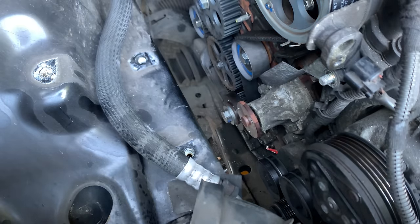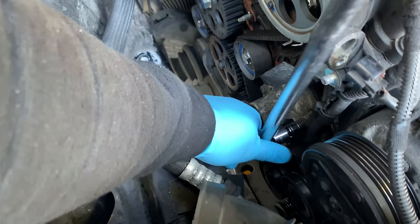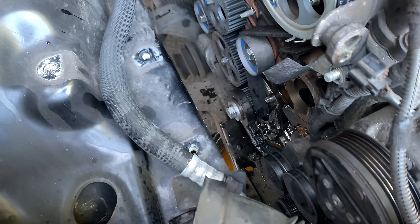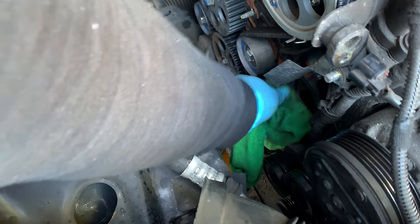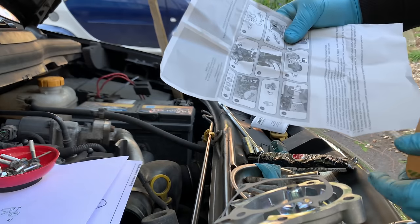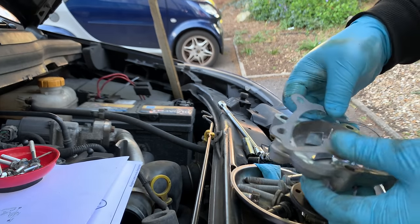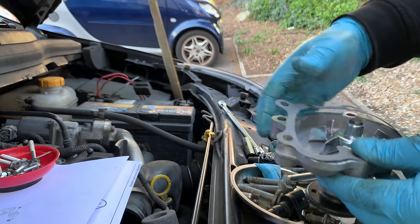Now we have — 12mm, yeah they are 12. Five 12mm bolts. The old pump is out — the surface is really nice and clean. I'm just going to use my cloth here to wipe any moisture, but it's super clean. Right, so for the new pump I don't have any torque spec whatsoever so I'm going to have to do it by feel. We've got another gasket to go on — don't need to put any sealant or anything. And it's ready to go.